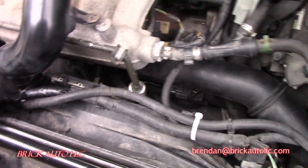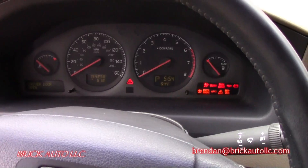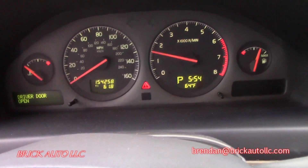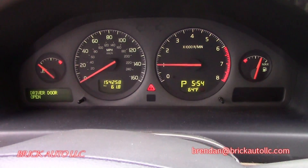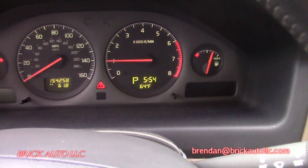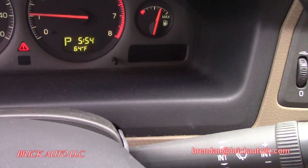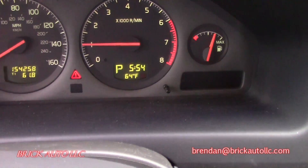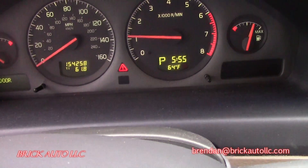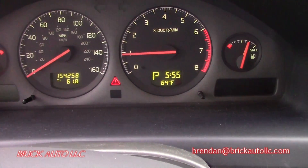It is time for the ultimate test — let's see if it starts. A little chuggy here at 1000 RPM. I really don't like that. I don't know if this is going to need a reprogram, or maybe it just needs to learn. It's kind of smoothing out there, which I like. Let's see what the scanner says — there are a lot of throttle position codes, all total throttle position codes in here.